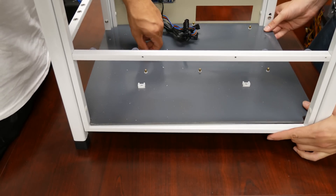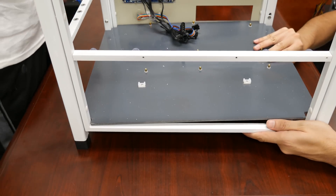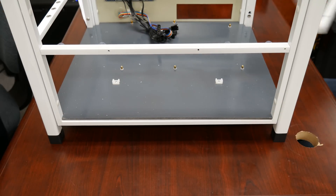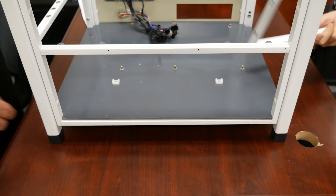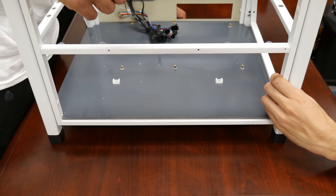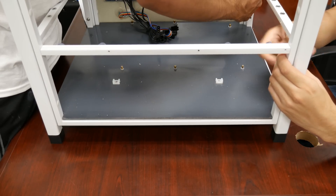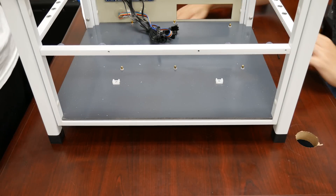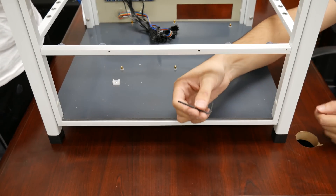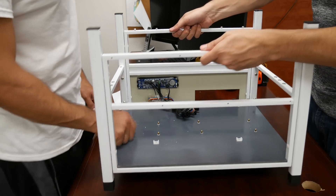Is it the other way, upside down, or is it this way? It's this way because it's the CPU side. The motherboard goes on the bottom. Now where's the other piece? It's right here. So three and four — I'm matching it. Three, four and seven and eight. Where's all the screws? Now the last screw. That's not too bad. I'm just gonna use this Allen key that's included to close all the screws. So here it is — the frame is all ready to go. Now we have to install the power supply and motherboard and all that.